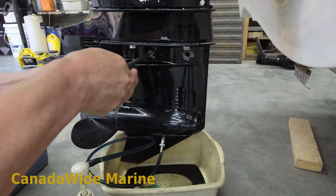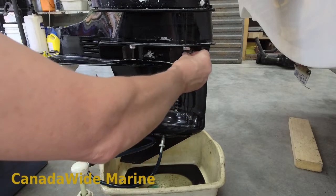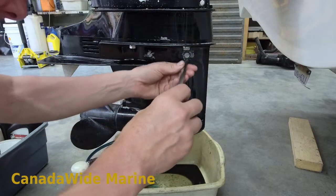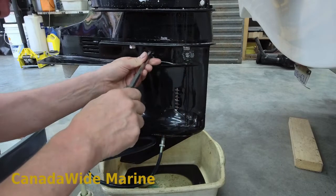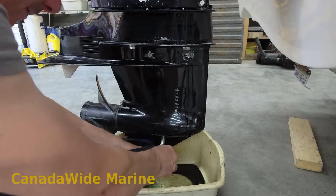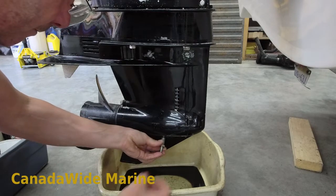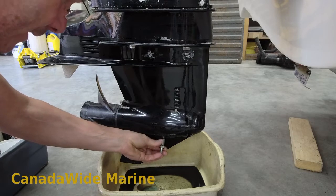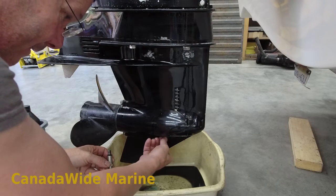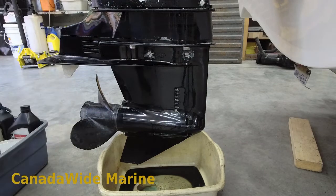Plug it up, and then another pump pushes it out of the front one, so now I know there are no air bubbles in there. There's a bearing in the top here and you want to make sure that you don't have air caught around that, otherwise you'll burn that bearing out. Hose off and out of the way, with the plugs in the top - very little comes out at the bottom when you remove your fitting.